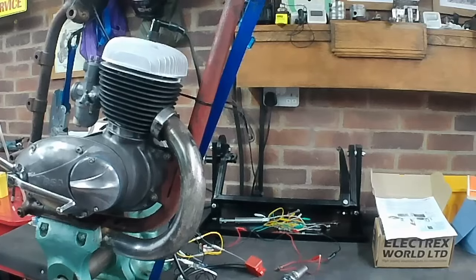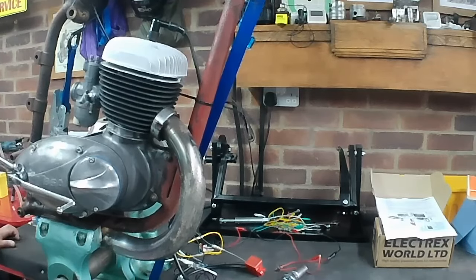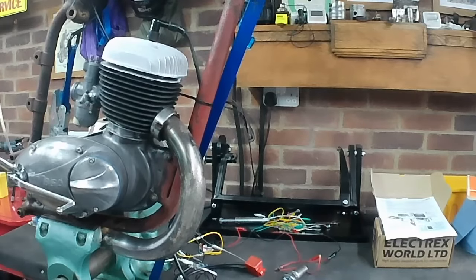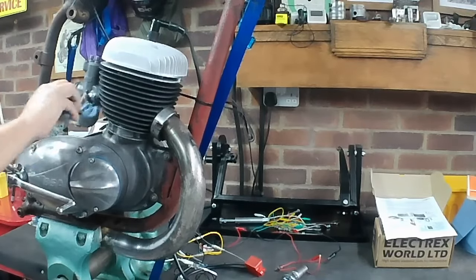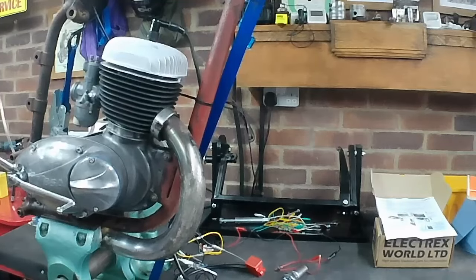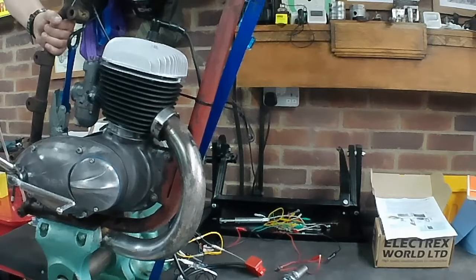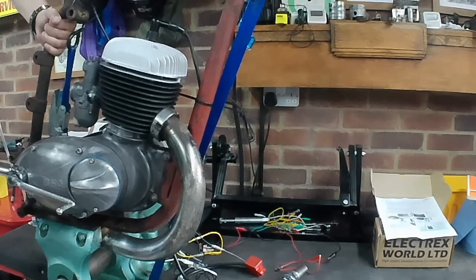We've got no throttle control, so that could be an issue, but the choke, as I mentioned earlier, looks like there's petrol bubbling out the back of the carburettor. Could be a problem. Right, this carb was pretty full of water, but it has had an ultrasonic clean, so let's see. I'm going to climb up here and kick it. You keep an eye on the exhaust, just in case I miss something. See what happens. Don't try this at home, folks. Or do, because it might be quite good fun. Who knows?